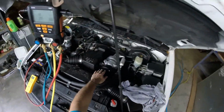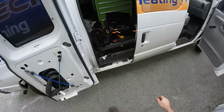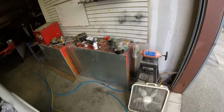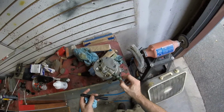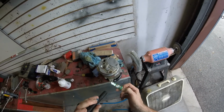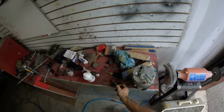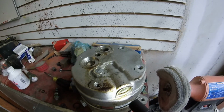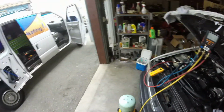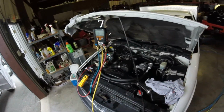Another thing to note is we won't see this compressor cycling, because as I mentioned in the other video, this is an unloading type compressor. This is the actual unloader valve here. It's held in with a little circlip. Basically this valve opens and allows discharge gas to go back into the suction, and it bypasses itself to reduce capacity. I don't know if you guys can see anything in there, but just wanted to note that you will not see this guy cycling. But all right, without further ado,